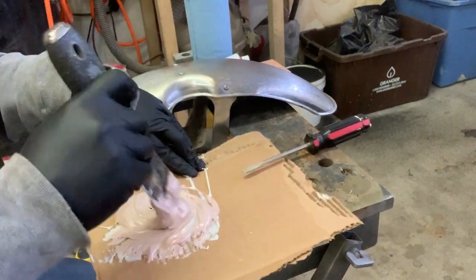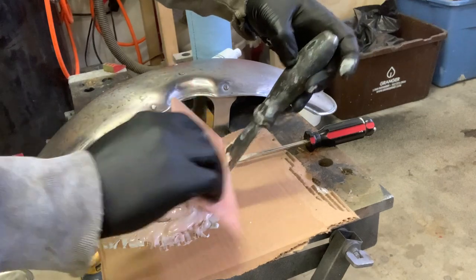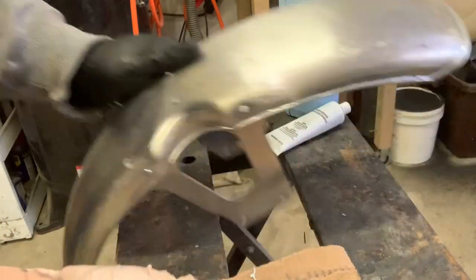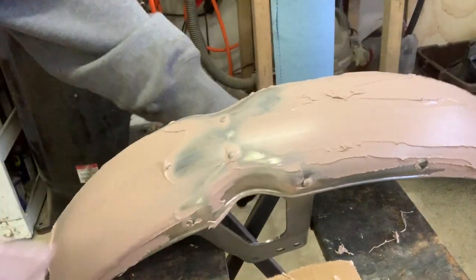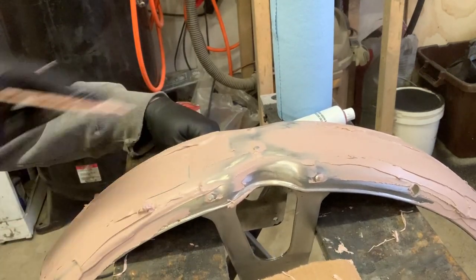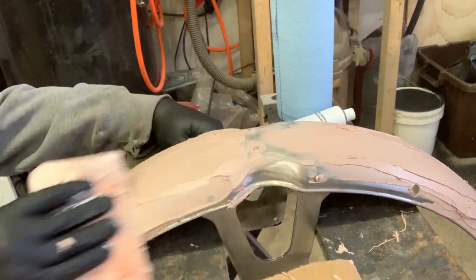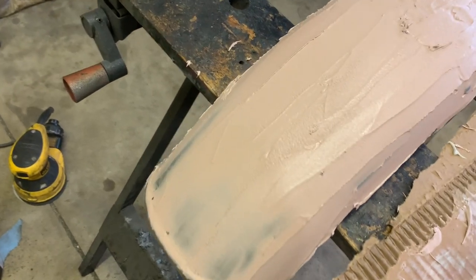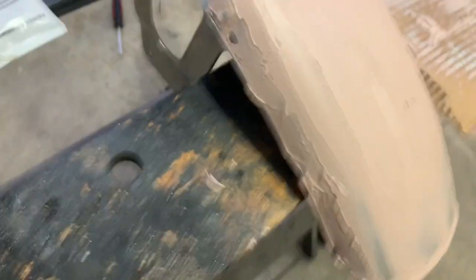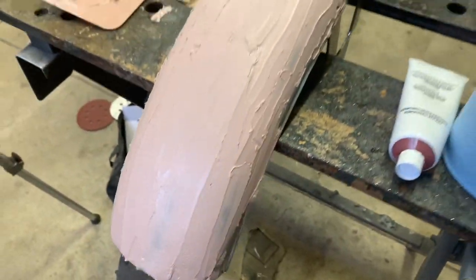I'm going to have to work pretty fast. Let's get to work on this fender — identify some of these bad spots and just start laying it on. I just want to make sure that I'm hitting all of my imperfection spots. There are a lot of them on here. So I'm going to just try to get this laid out as smooth as I can before it hardens up. You can see I got it down in there pretty nice and smooth. I think that's going to sand out pretty darn well. These were the real trouble spots. I think I got a good start.